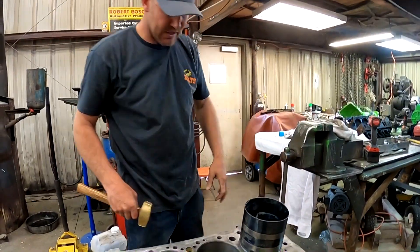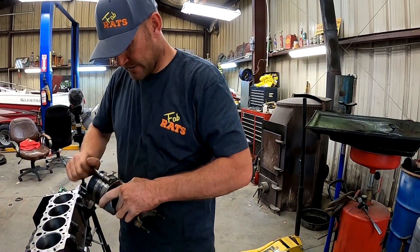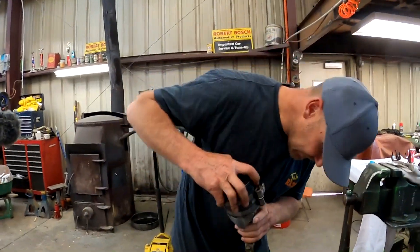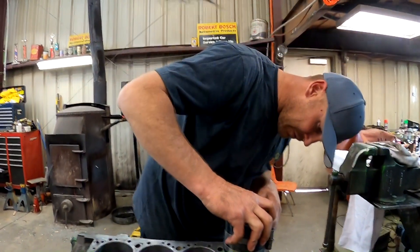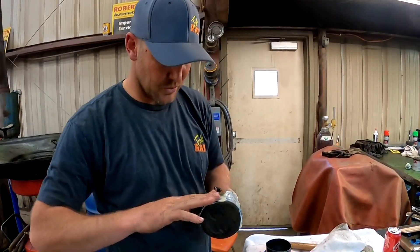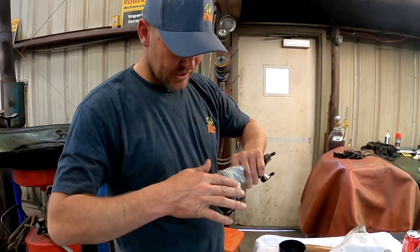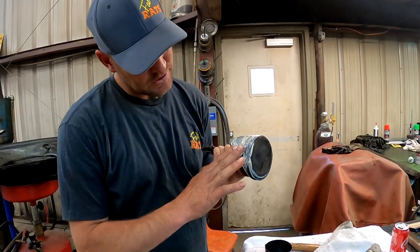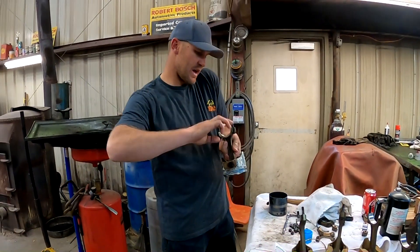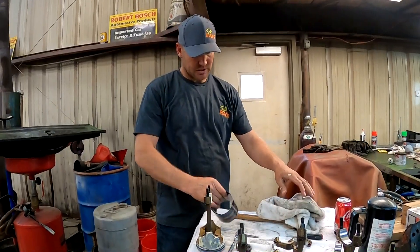It's not having it. I didn't buy any of these parts — they were all just given to me. The guy was moving and said I could have them. It doesn't feel like the oil ring wants to drop down in there. So we figured out the problem — the oil ring is a different style. What we did is we took the old inner part of the ring and put the new rings on it — basically a little hybrid action. It's got new rings so it should work just wonderful.